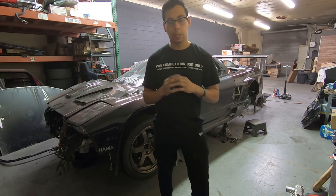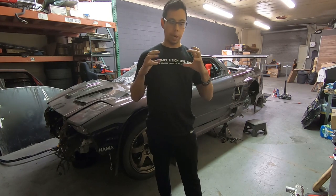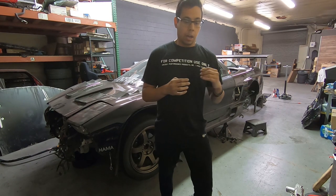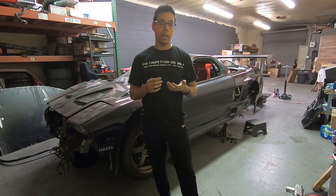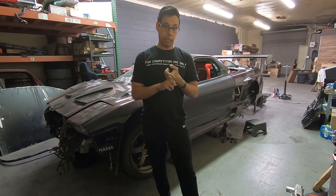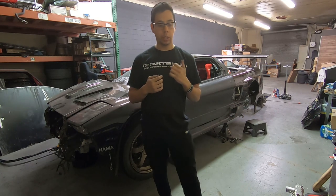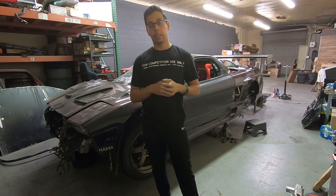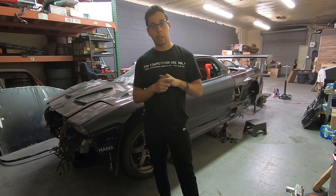Other dog boxes have 6 teeth, what they call the dogs. And they basically mesh into the gear, and because of that, you have to shift it really quickly and you have to be very precise, otherwise you'll bounce the dogs off of each other and shred them. It's really easy to damage a Dogbox. Essentially all motorsport, sequential, all the race transmissions are all dog engagement.